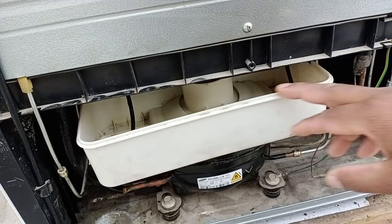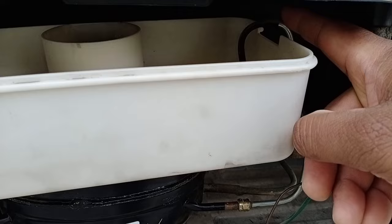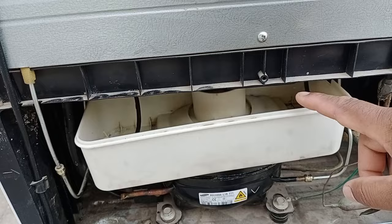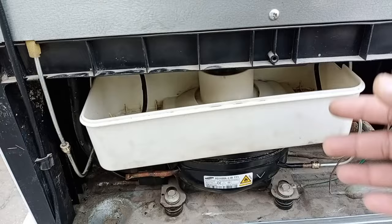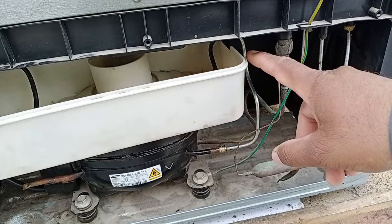In case the water level gets above the tray, the company passed the discharge pipe through the tray — you can see it passing through the tray with a coil made inside, and then the pipe enters the body of the refrigerator. This has two benefits: first, the water vapors out of the tray into the air, so we don't need to remove water ourselves. Second, when gas flows in the discharge pipe, the water in the tray helps the discharge line cool down, improving refrigerator cooling performance.